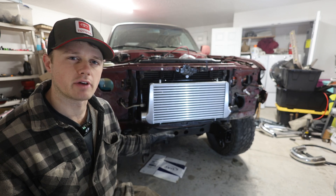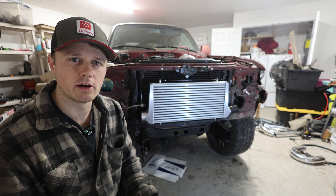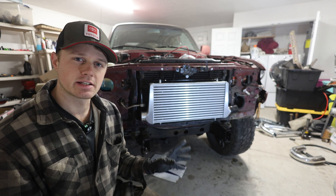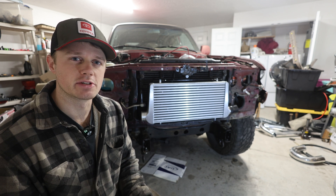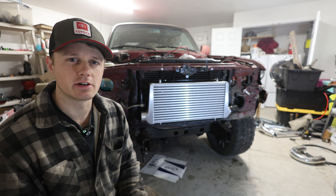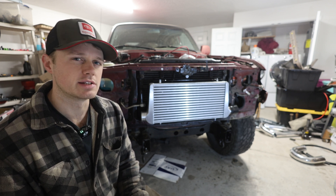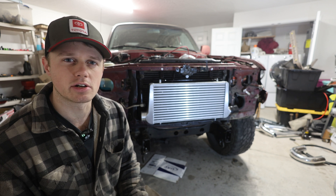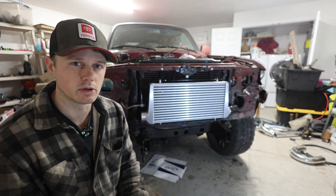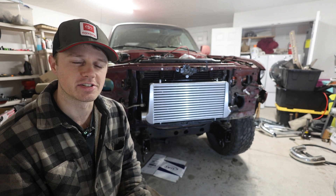The previous intercooler piping from Dustin used a really cool method to go beneath the engine and come out on the frame rails — you did have to drill into that front cross member and then weld in the three-inch piping, but it was very clean. This may not be as clean since we've had to cut into our fenders, but we're gonna make it work. The one thing I don't like about going this route is that you have to drill into your fenders and the charge piping will come through the fender well, so you need to take that into consideration if you're running bigger tires.